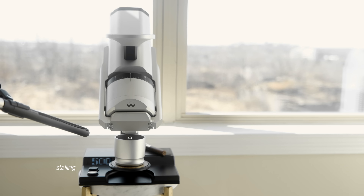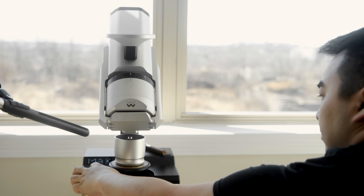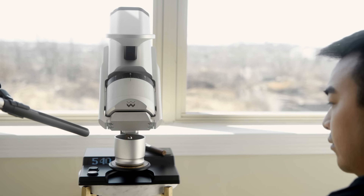Weber encourages — and I personally also tend to — hot start the grinder, meaning it's on and running before pouring the beans in, as opposed to a cold start where you pour your beans in first, then start the grinder. That's primarily because this grinder stalls, mostly at a lower RPM. I've noticed that occurring around 700 RPM and under with lighter roasts, and at 600 and under you definitely need to slow-feed your beans. It's easily fixable by pressing the black button, which first reverses the burrs then ramps up to maximum RPM to clear any jams. There was one odd occurrence at a coffee meetup where the grinder momentarily died and the display stopped working, but turning it off and back on after a couple minutes resolved the issue.